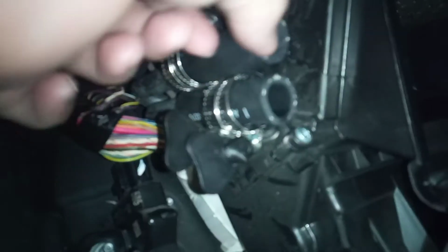Here's underneath. Look at my heater hoses slid onto the aluminum pipes. You want to slide them back on there as far as you possibly can. That way it doesn't interfere when we slide the heater core in, and then we'll grab them and pull them back this way and secure our clamps. Don't forget to hang your clamps on there beforehand before you put it in, because that'll save you some trouble fiddling with everything. Let's slide the heater core in.